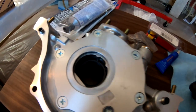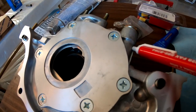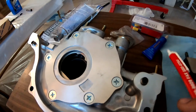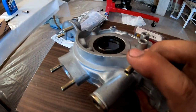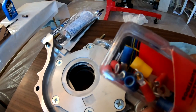I know that on Chevys and on some Fords you could buy the spring itself and choose the tension of the spring to increase the flow and increase the pressure of the oil. That's always been like an old school trick — just to swap out the spring in there. But what I'm gonna do is just use this little shim.